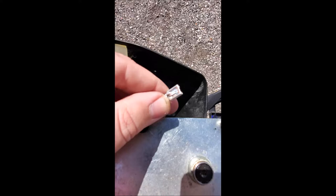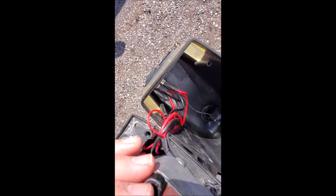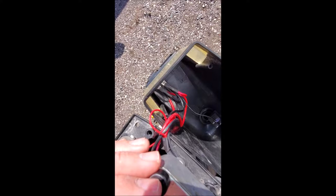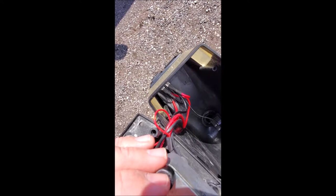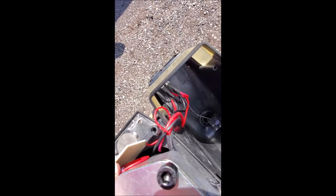The reason this job was more difficult is that the first two connections I could pull a little shrink piece back, which wasn't a big deal, but the insulation on the other spade connections is heat-shrunk on. If you were a pro, you'd probably cut that off, put a new one on, reconnect all the connections, and then shrink it with a heat gun. I don't have that luxury, and it definitely made the job much more challenging. You've also got to be very careful reassembling them so they don't fall off while driving. Not a complicated or dangerous job, but definitely a pain if you don't feel comfortable doing it yourself — get a tech to do it.